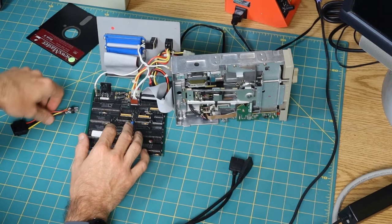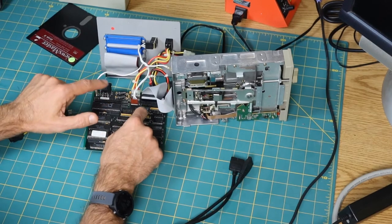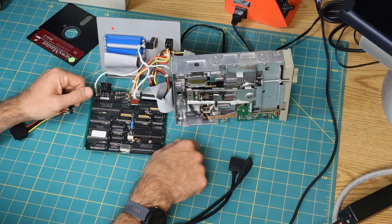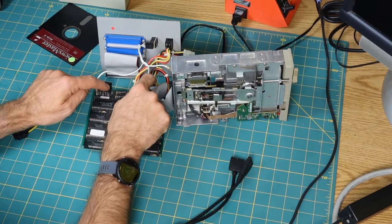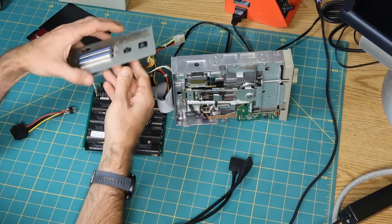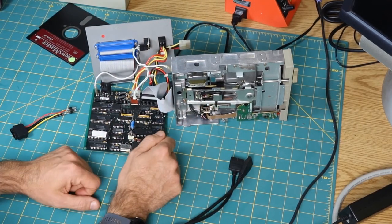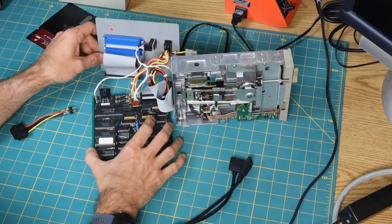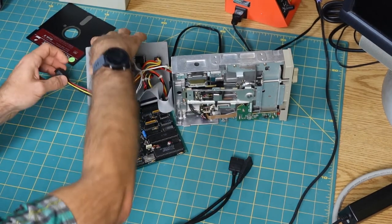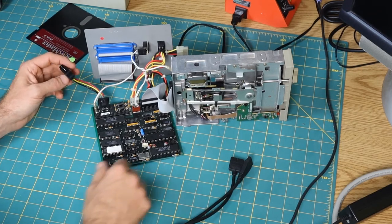The other thing to remember, if you're going to try to use a multimeter to figure out where lines go on this: when I was first doing it, power wasn't going anywhere, and I was really confused. Like, how is there not continuity between these two points? I didn't have any of this hooked up, so I didn't have the power switch on. So there was an open bit of circuit in the way that was preventing what I was trying to do. You know, the things that should be obvious. What is it that they say? Common sense is the stuff that you know right after you needed it.